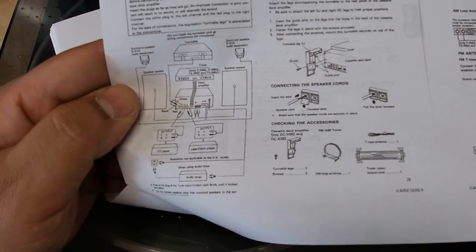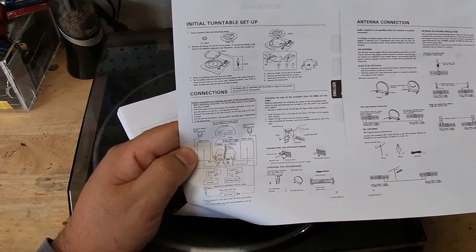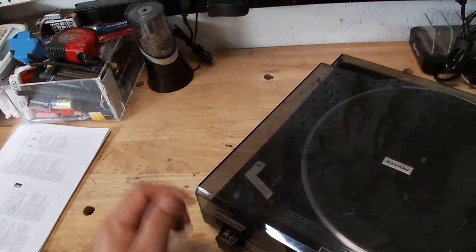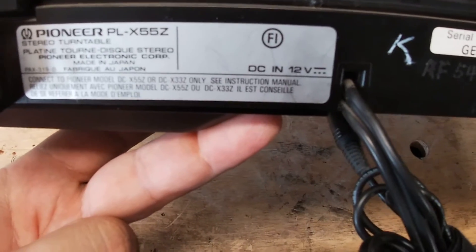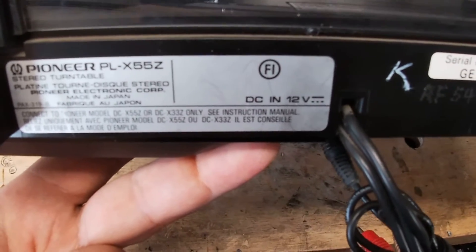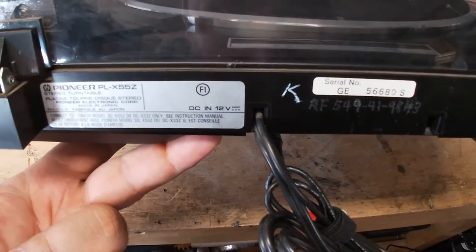All they really show is how the turntable is connected to the amplifier it was supposed to come with. The amplifier connections are not actually shown in this manual, so there's no clue as far as the amount of amps this turntable should be getting in order for it to function. The only clue we have is in regards to polarity and voltage, but they don't really give how many amps we're using. So the best thing I can probably do is start running this on a power supply that's 12 volts and half an amp and see if that helps it run correctly.